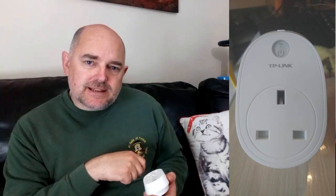Let's talk about the setup of the HS110. First, you need to download the TP-Link Kasa app — that's K-A-S-A — available for Android and iOS. Just plug the device in; there's a button on the front. Keep that button pressed for about five seconds and the Wi-Fi light turns amber. Start up the app, it will find the plug, you enter your Wi-Fi details, and that's it — you're all set. If you ever need to reset it, there's a button on the top; press it and start from the beginning.